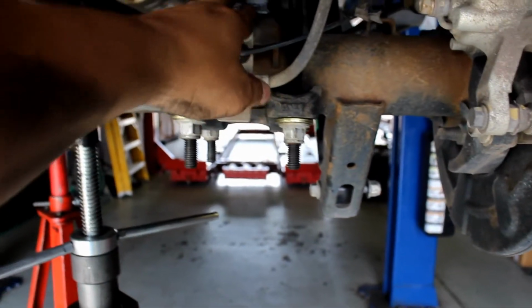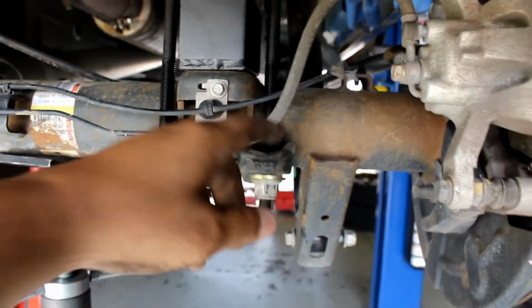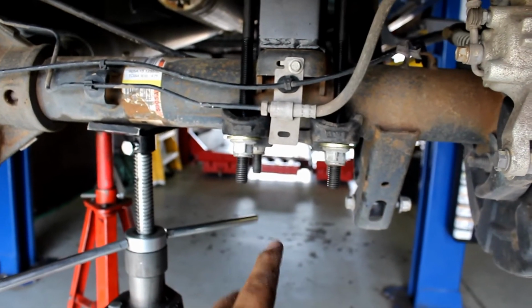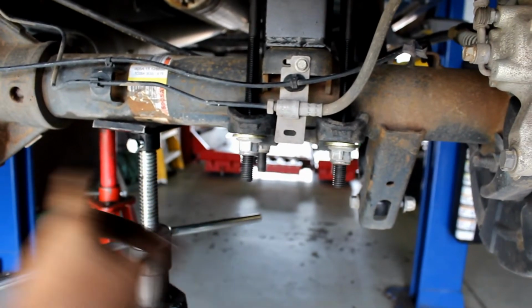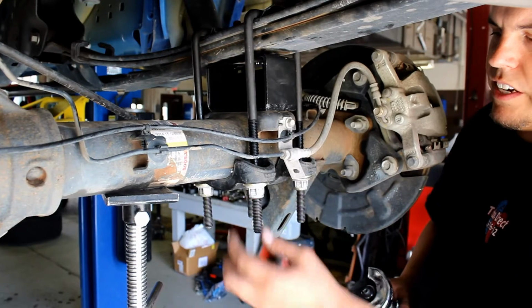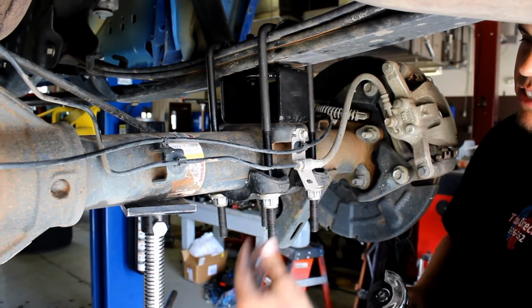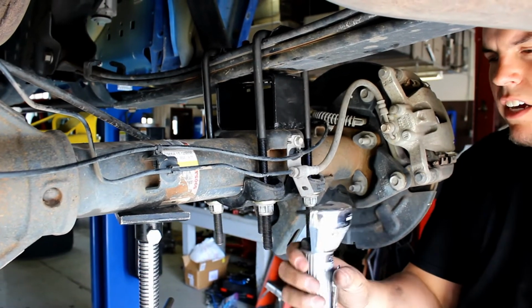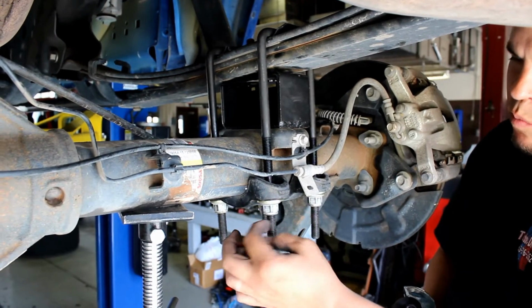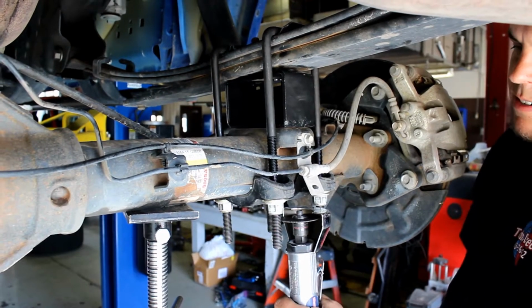And then now we'll start raising this up slowly, making sure all the wear marks line up. As we go up slowly, I'm going to be tightening the nuts on both sides slowly. All 4 on both sides. With the deep well socket I'm using, there's too much thread to even tighten these all the way. So I'm going to cut everything but a 1/2 inch from where it's at right now with the angle grinder.